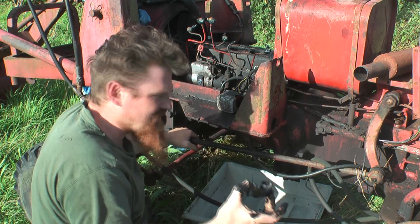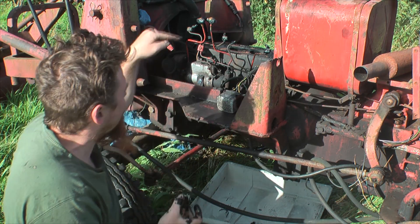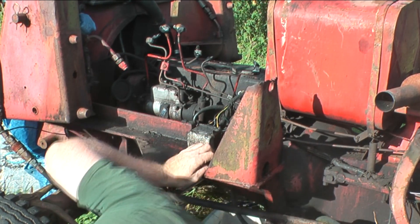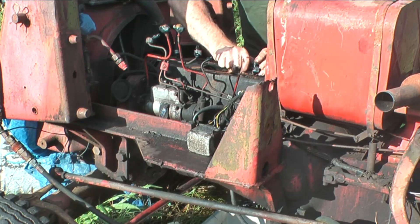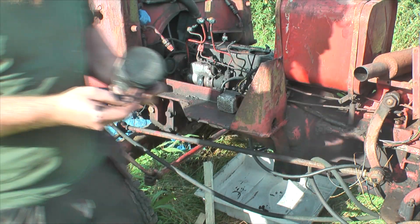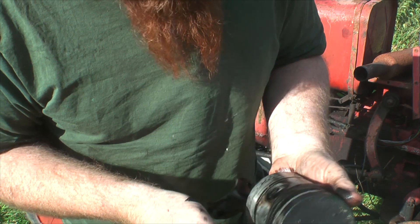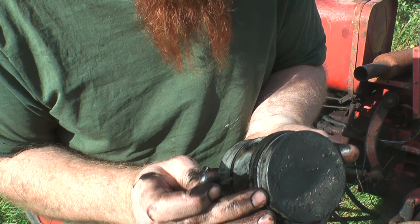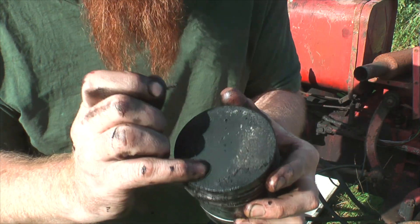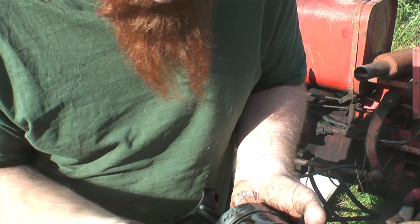That's undone that, which is the bottom around the crankshaft. Now the piston should poke up and out through the top. There's a piston. On initial inspection, the piston doesn't look too bad to my untrained eye. But what happened when I pulled it out — the top piston ring was broken. That certainly wasn't helping the compression. And you can see here how coked up it is on top. That was definitely broken before I pulled it out.